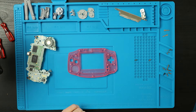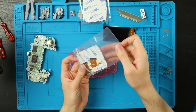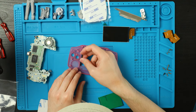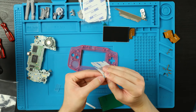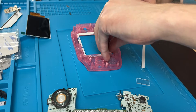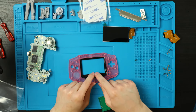We can place the shell down and get out our mod kit, which came in very cheaply packaged but at least the screen is in some bubble wrap. We've got two connectors and two pieces of double-sided tape. The kit has us use one piece here and stick it down on one side to even out with the bumps, then put the double-sided tape on top of that. We flatten that out, punch it through, and peel it back. In the instructions there are two pieces shown, but there's only one piece here, so I'm just putting it down in the middle to keep it as even as possible.